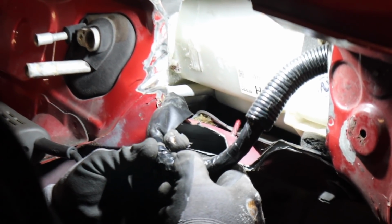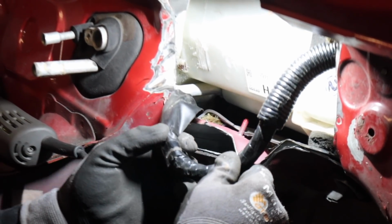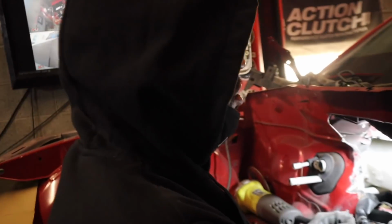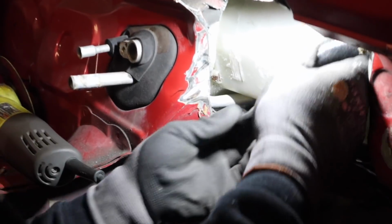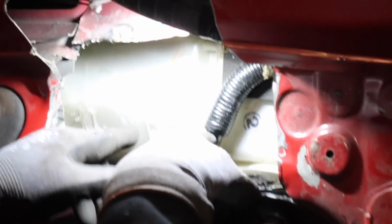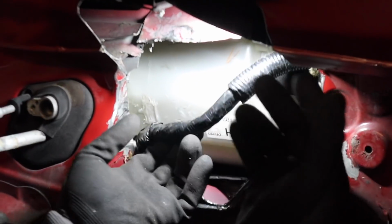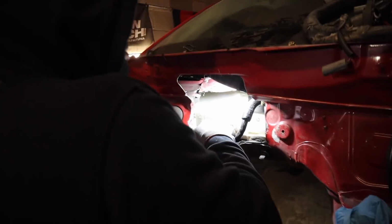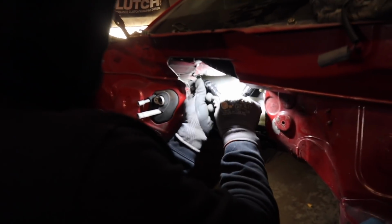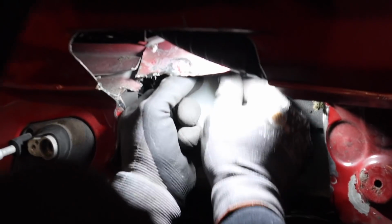What'd you do under there? You just unclipped it from two harnesses? Not yet. So what I did was I got under the dash and I ended up just unclipping the two zip tie holders. And you were able to flex and move that a little. That part of the wire right there was hitting our cam sensor. Yeah, the cam sensors sit right here. So we had clearance and we could have probably butchered our way around it, but we're already here. We might as well take our time and do it right. So we unclipped it. Now we just tuck it up, and there's a nice little pocket up there. And the harness sits right up there, out of the way.